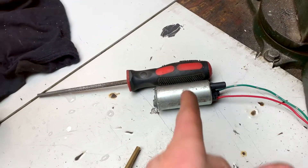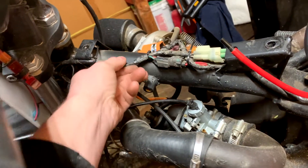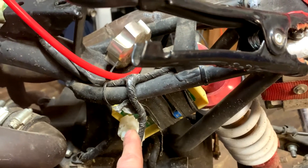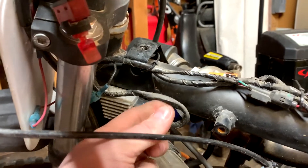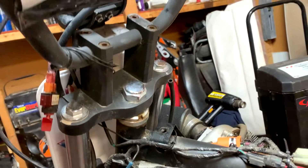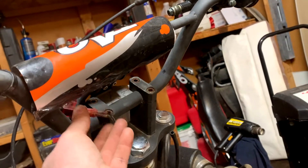It does work - that's a screwdriver handle for scale, it's a tiny fuel pump. I made this wire harness out of Honda parts; I took an old Honda 400EX wire harness and made my own. This is a DC CDI, and I have a battery charging mainly to control the CDI box because it's a DC-fired CDI and needs 12 volts. This stator fortunately did have a yellow and a white wire; I hooked up a GY6 scooter regulator right there. The wire harness looks pretty clean, other than the light wiring which I just never got the chance to tidy up - I'm going to put a mounting plate for the light switch or drill a hole and put the switch behind the headlight.